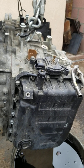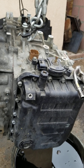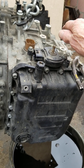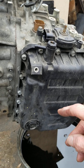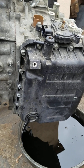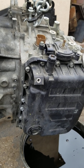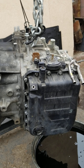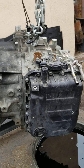All this stuff is accessible. You have to take out the induction system to get to the fill, because it sits all on top of here, and the battery sits about right here. So to get to this fill plug, you have to take the induction system out. This right here is readily available. The drain plug is readily available. But this is not a particularly hard task — it'll save you some money. Instead of going to the dealer and having them do it for a couple hundred bucks, you can do it for the cost of fluid and a little bit of your time. I wish you good luck in your projects, and I hope you have a wonderful rest of your day. We'll see you next time.